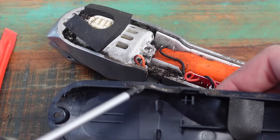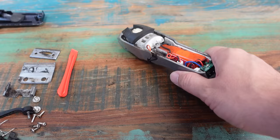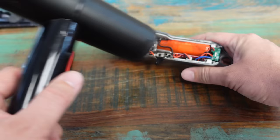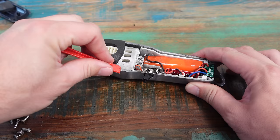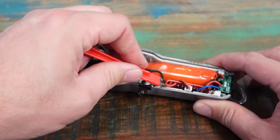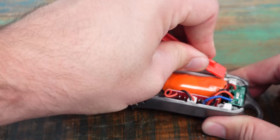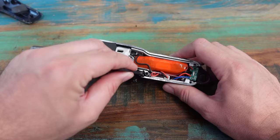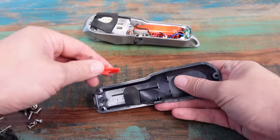And as you can see, one of the moving parts — the switch — has some hair build-up around it and some gunk around the edges. That's probably hair product and bits of hair. So I'm going to clear all this out. I'm going to use my hair dryer on full blast to get that cleared out. Then I'll go around the edge with my lever tool and scrape off all that gunk, making sure it forms a nice seal when put back together so no hair gets into the mechanisms or clogs up the switch.